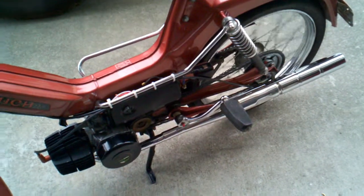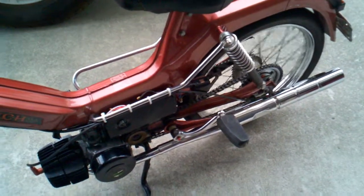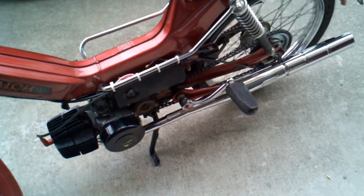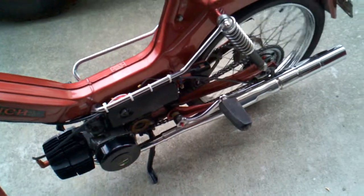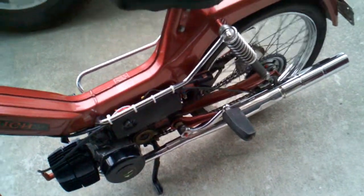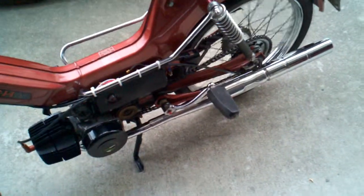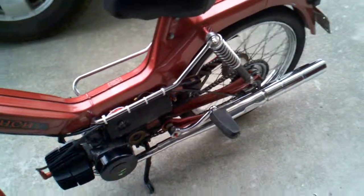It's a techno pipe, compared to the ID on the other pipe, even the Biturbo — big, it's like a header. So I think I'm going to put a little port job on the exhaust port down there, and match it to the exhaust pipe. It should give me a little bit more, and it looks totally stock, which I kind of like.